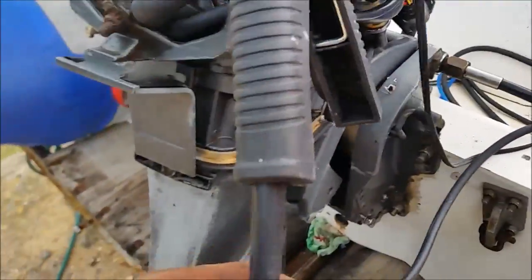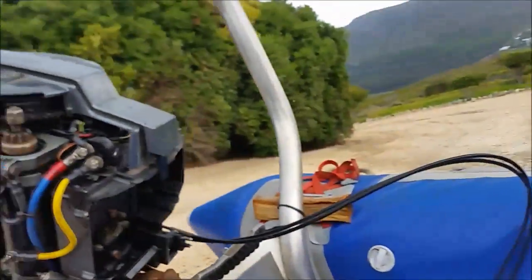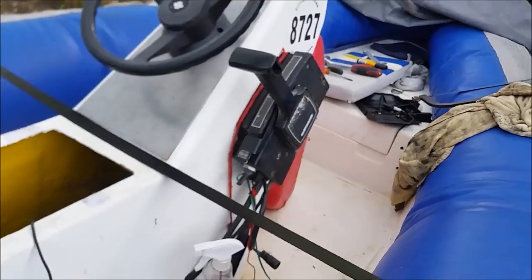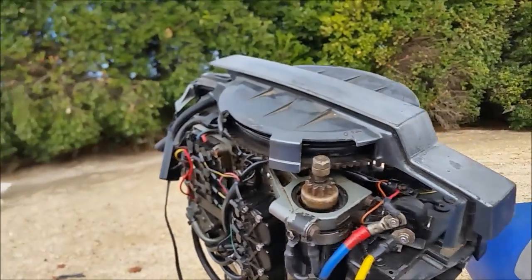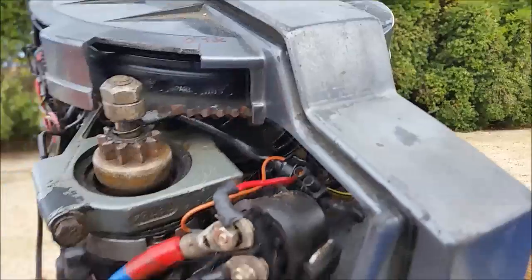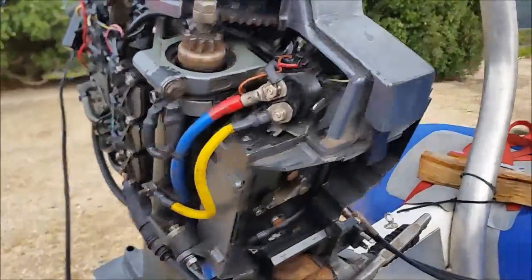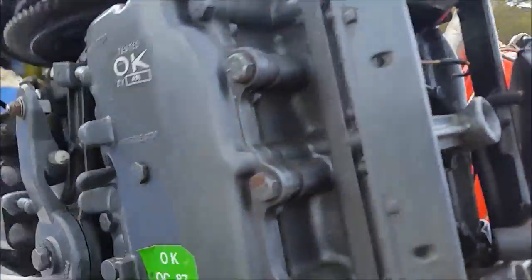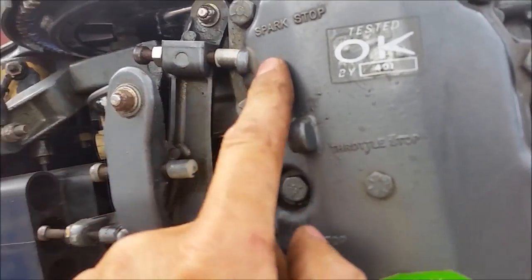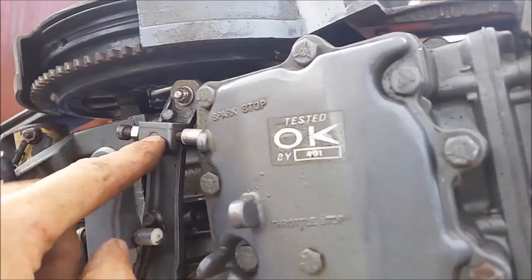Put the other end, obviously, on the negative side of the battery. Just bear in mind these cables can be heavy — you don't want to be pulling on your plug wires. Just fire it up. Make sure when you're aiming the flashlight — I was working alone without a friend — you've got to have a very perfect line of sight, so it's good to just rotate the motor so that your TDC mark is facing you perfectly. All you do then is crank the motor. I have to push my key in to get spark, and the timing light is going to flash there. Just keep adjusting your max spark stop until you're on your factory setting. Mine's 28, which is very high. That is your max — that's what's going to control your engine's maximum spark, and that's probably the most important thing to get right.